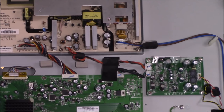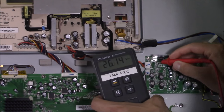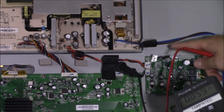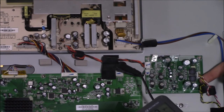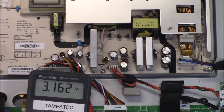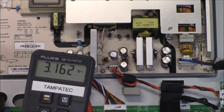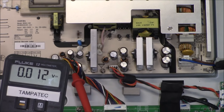We can also check the audio board — the voltage going to it is good, so I should have audio. This is the amp, and this is my amplifier chip. If I'm getting very low volume, I would change out the amplifier chip and see if that increases volume. This connection here is directly connected to the speakers. My on/off pin is reading 3.1 volts. When I hit the power button and turn off the TV, it goes down to zero. Every time you turn on the TV, you should get that 3 volts.